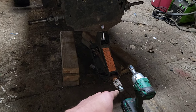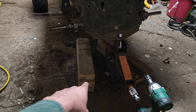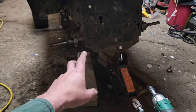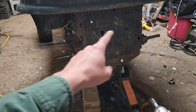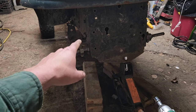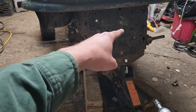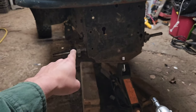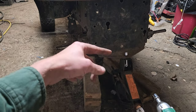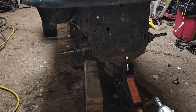A three-quarter-inch bolt welded onto a car jack impact, and six two-by-fours — three on one side, three on the other. Get underneath, undo your shift linkage, undo your brake so it can drop out, and free all of the nuts and bolts — one on this side, one on that side, two there, two there. Lower the whole thing down, take them all out, lift the whole chassis up, and slide your transmission out.